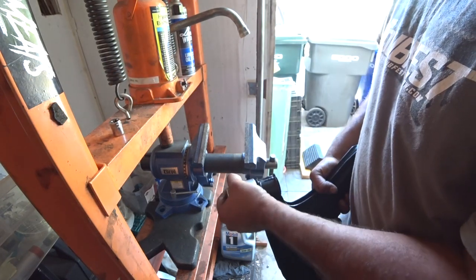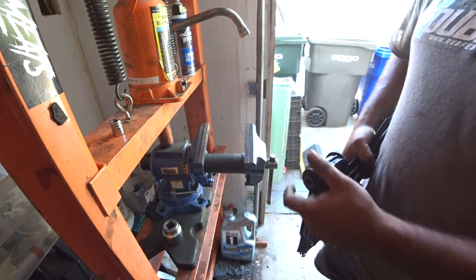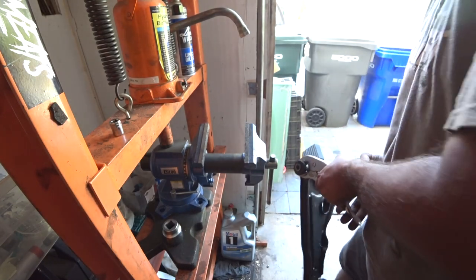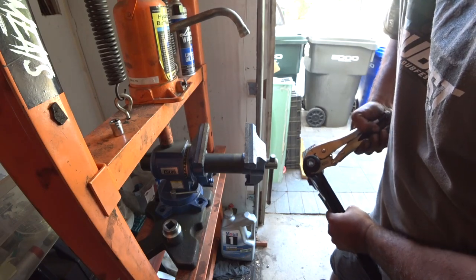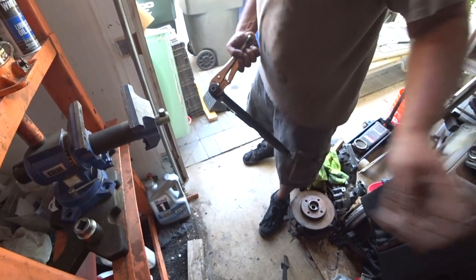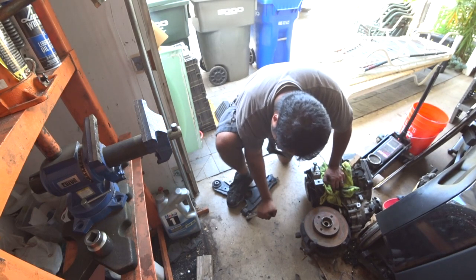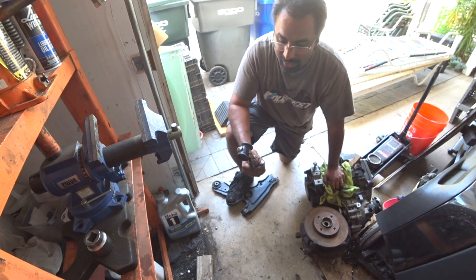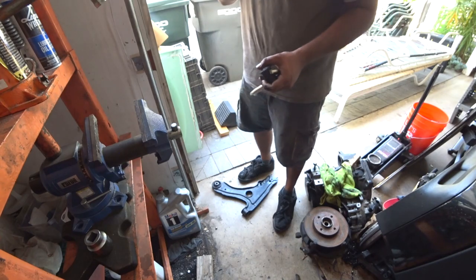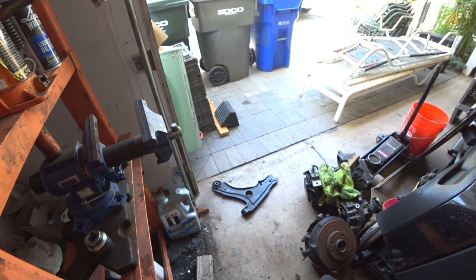This one out, and then just, you'll see the bushing's almost 100% out. So what you have to do next is grab a set of vice grips, point down, put it on the floor and twist. Just like that, you get it out. Pretty easy. Reverse the process to install the new bushings. Very, very easy. I'll film that too, but just to give you guys a heads up.